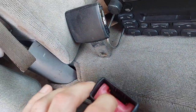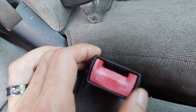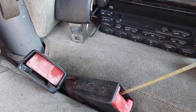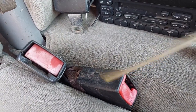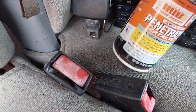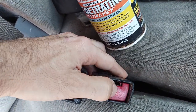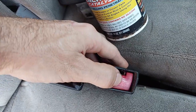For the middle: it goes all the way down, it comes back up but it's crunchy, so it needs some lubrication. I'm going to get some PB Blaster in there — quite literally spray it in there. Bonus if the button is up all the way so you can get full access to the buckle mechanism. After you get some sprayed in there, just work it. I follow this up with some lithium grease so that it will stay unstuck.